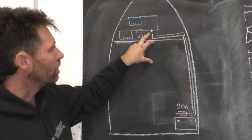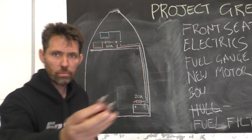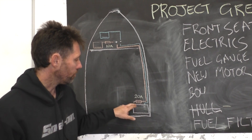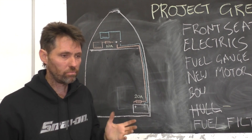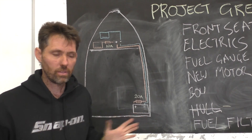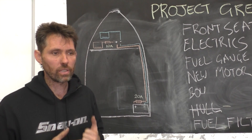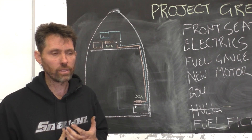I'm gonna come up to the front and stop at a two-post terminal block. The reason I'm using this is it keeps it simple and reasonably versatile. All it's really doing is taking the two battery terminals and giving you a replication of those terminals up under the bow on a fused circuit. I like the idea of building these circuits as modules so you can look at one and go - power arrives at this point, and if it branches off, you can take each branch in isolation. Things can be complex without being complicated - each section can be simple and understandable, and that's what stops you ending up with a bird's nest of wires.